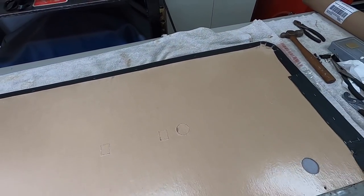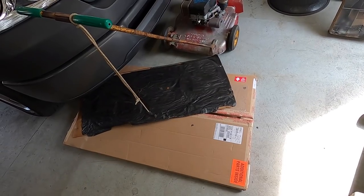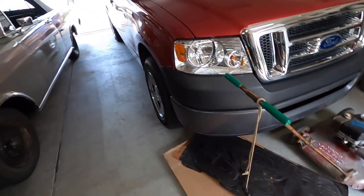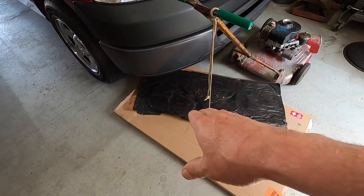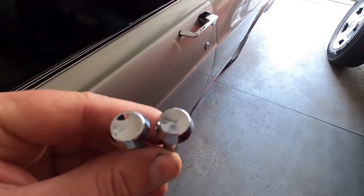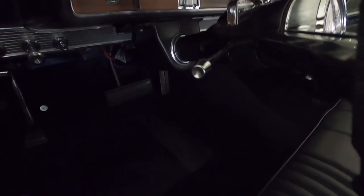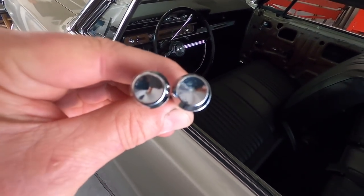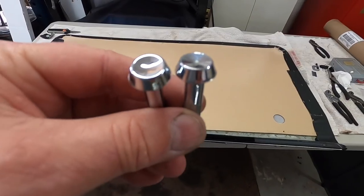I'm going to put the other door panel together, then put the paper on the door, make sure all the pieces are in their correct spots for the handles and latches, and then install the door panels. There are my patterns to make the new door papers, and I'll double-check the holes on the door panels with the papers before I install them. I need to find my ribbon caulk because that's how it was held — it was tucked into a drain and taped on the bottom. Another thing: I'm going to reuse the original lock buttons. The reproduction is rounded and dished, but the original has a pointy top — the same pointy look as the turn signal switch and lever.